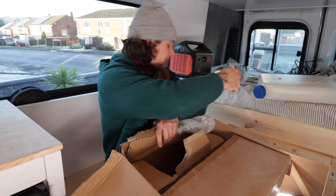Just go full whack, fast as you can, and then lightly press it on. Don't press it — let the drill do the work. There we are, big hole in the floor. I've actually just sprayed around it to stop the metal corroding. I'm going to put the turret plate in and then seal around it later with heat resistant silicon. And it's always going to get warm in there so there's no real worry of rust. Turret plate in — easy as. Just five screws.